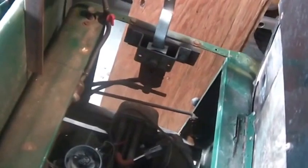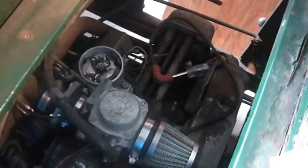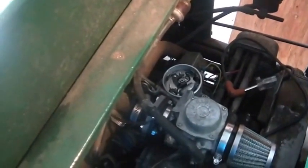I mean, this thing had quite a bit wrong with it. I had an open wire. I had plugs that were a little shaky. I cleaned them up. The points, I'm saying they were open too far. Maybe they were open a touch too far. I'm also thinking that they might have had an issue with that bad cap, that they were arcing all the hell. I borrowed the capacitor from the bike out over there. If you go through that door and go straight, you almost run into it. So this thing is fixed. Finally, it's fixed.